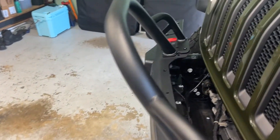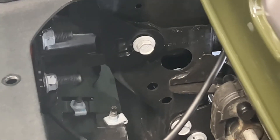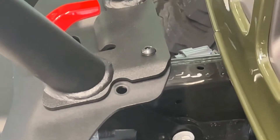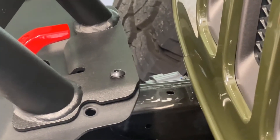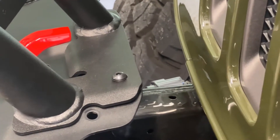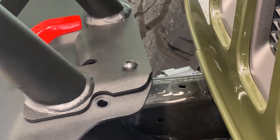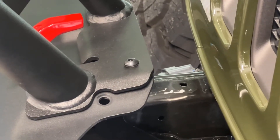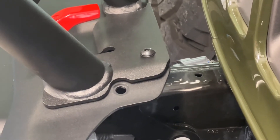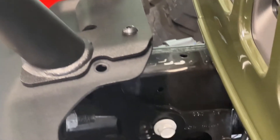The reinforcement bracket has to be angled so the bolt will go through right there — that's the only bolt on each side that you need to put in. It's got studs for the other two bars and then one screw, which is an allen head and a little bit longer than the factory T45, so you can get a serrated bolt on the back side. Underneath the studs and this bolt are rubber washers, so it goes in between your factory bumper and the bull bar and cinches it down.